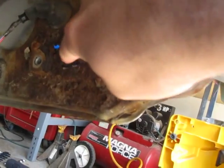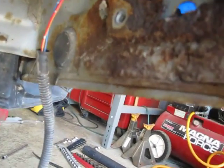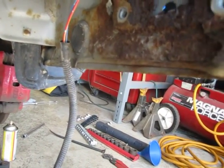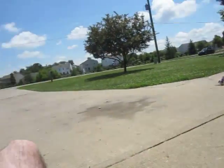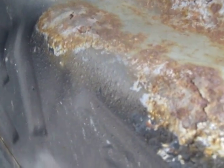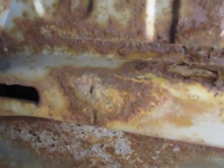You can see where it mounted here. This is multiple layers — this is the back layer. Right here where you're seeing paint is actually an inside layer, not this outside layer. It's separate from this layer. So I'll probably fix this while the cars are parked. You can see the actual pan is pretty bad — this here is an actual hole that I've got RTV'd inside to keep water out of the trunk. The pan rails are more or less gone.